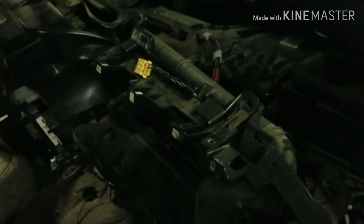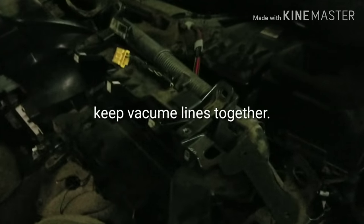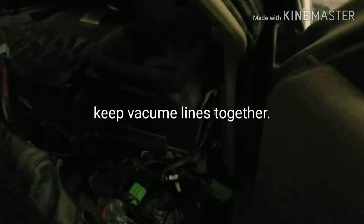You're going to take everything loose — your dash, you're going to unplug everything, unplug your blocks, your PCM, your ECM. You're going to pull this box out and then take the box apart. That's going to be the easy part. The hard part's been doing this and putting it all back together and trying to remember where I was. Because I'm a mechanic, but I can tell you this is a nightmare. Everything is just torn apart.